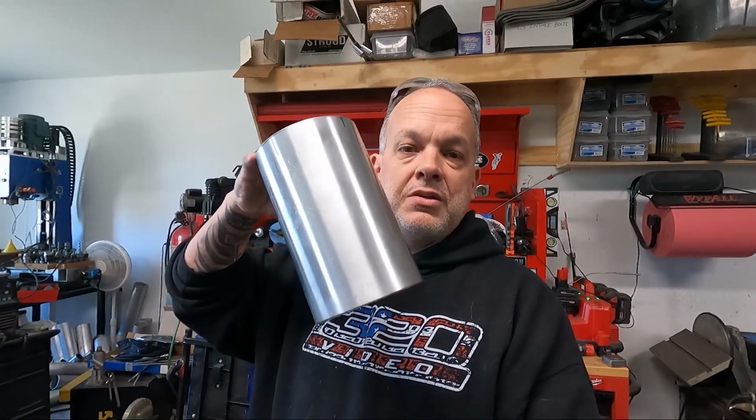So in this case, these are just pipe thread and they have to be cut off. So there's the one that goes on the bottom of the catch can. That's going to be for the drain valve, like this. And then this will be the catch can. This thing is 5 inches in diameter, 8 inches long. This will be for the breather that goes on it. This is the piece that welds into the bracket in which it mounts to the frame with.